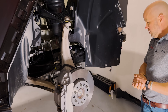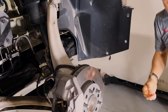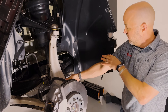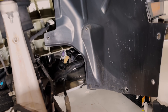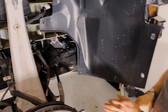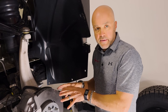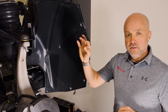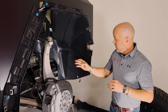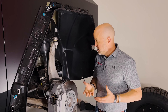Looking in here it's just regular vacuum-formed plastic shielding for the wheel cavity. Steering-wise, we have steering by wire — there's still a rack, but from a wheel and chassis perspective that's not where the magic is. The magic is in the computer, the inputs from the steering wheel, and then the servo that does the actual steering. We'll see some of that in the back too.